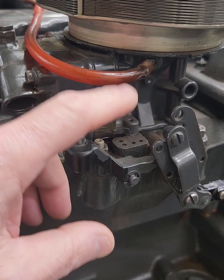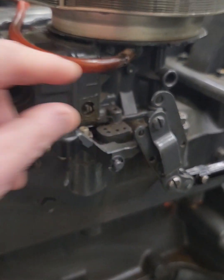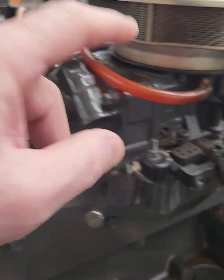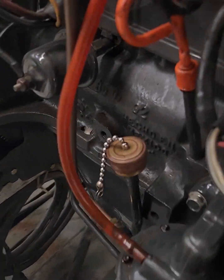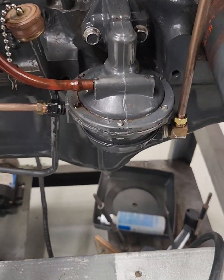Take a piece of this hose to any auto parts store and you can find a rubber cap that'll fit on there. That just caps that line, because electric fuel pumps are not vented. So if you do the conversion, that is what that third hose is that he was questioning.